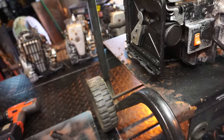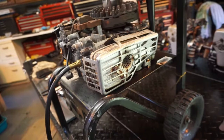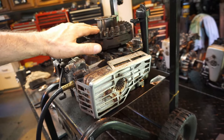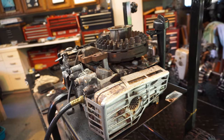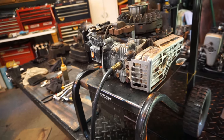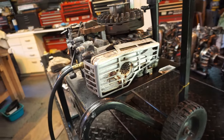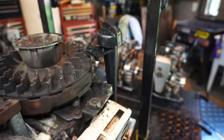These were Intech motors - very good motors, much better. I could put a newer motor on but I need to find one with a 7/8 shaft. You'd have to have a flywheel like that - it has to be for a pump, like a pressure washer. I think since I just did a valve job on one, why don't I grab all this stuff? I just put a different dipstick on - it fits better. The other one just fell out. When I spun it over it shot oil all over the place - it blew the dipstick out.